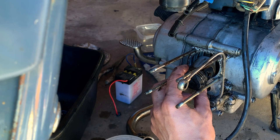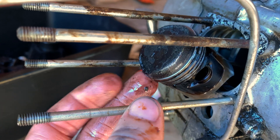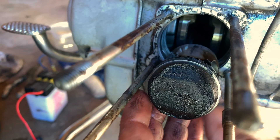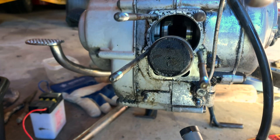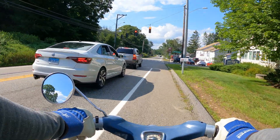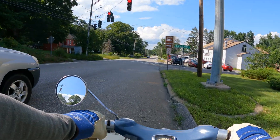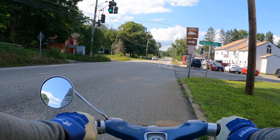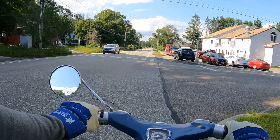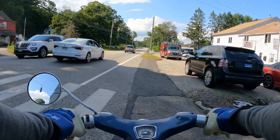I came here to replace this piston. I've always had some issues with burning oil, but it had gotten much worse over the last year, and you could see by all the scorching on the piston. Aside from occasionally having a tail of blue smoke behind me and having to top off the oil, the real unignorable problem I was having is that once my engine got hot, if I stopped giving it throttle, or if the engine didn't have the momentum of bike movement to keep it going, it would start to stall out.